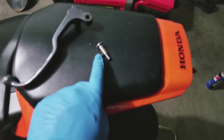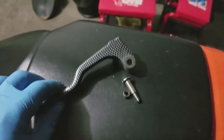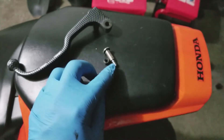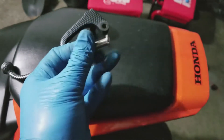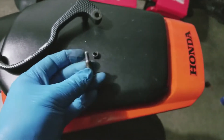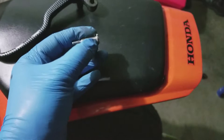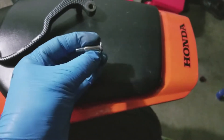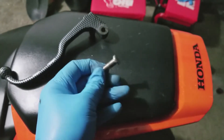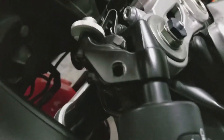Make sure you don't lose that nut — mine dropped out, good thing I found it. The bolt just goes right through there and holds it, then the lever comes straight out. This took a little effort to remove, so I'm going to put a little anti-seize on it so it'll come out easier in the future. I'll clean up the pivot so there's no dirt and grime to hold it back from the actuation when we clutch in.